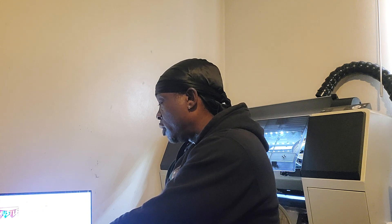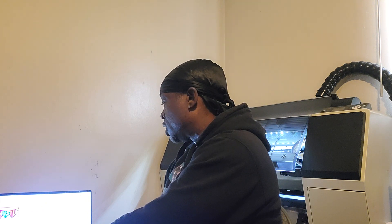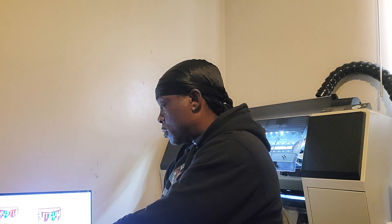When you clean your capping station — your spit box — you have to be very careful, because if it still has any moisture or excess water, solution, or whatever you're cleaning with, it's going to come in contact with the print head during a cleaning cycle. From what I think — and I'm not a professional — it tells the printer that it's using a foreign type of ink because it's not the same.